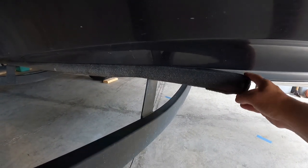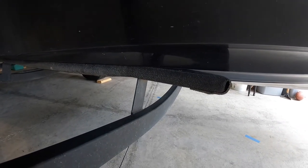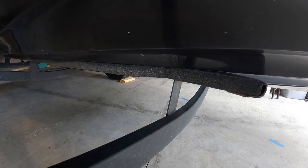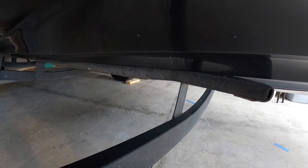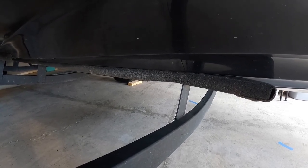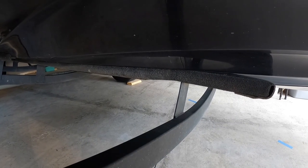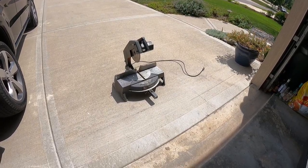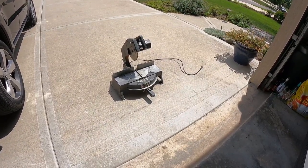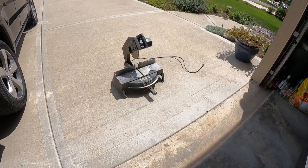Here's the bunk — it is completely just loose and rotted inside of that carpet. Like I said, I ordered the carpet on Amazon. I went and got some 10-foot 2x4s this morning and I'm going to cut those down to 9 feet, which is what these are on the Nitro. I used my old Sears Craftsman miter saw — it's just a 10-inch blade but it works for a 2x4. I cut them down to 9 feet and now we're going to get going on the carpet.